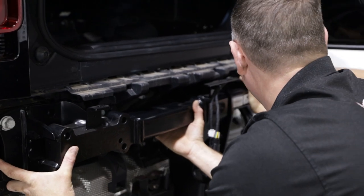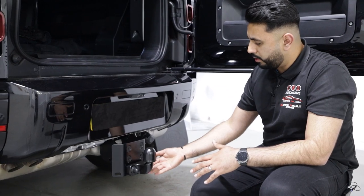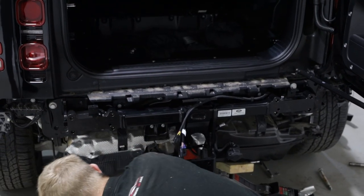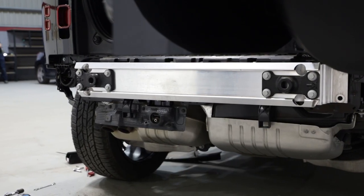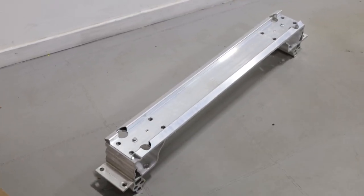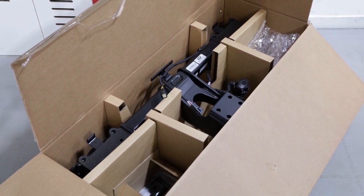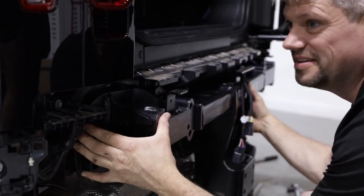It's very versatile, and with the adjustable ball here you can adjust that with ease — unbolting these and bolting them slightly higher up to adjust for whatever you're towing. One really nice thing about this install is that it involves removing the bumper completely and removing this part here, which is the crash beam of the car. Basically this is a safety feature that has been removed, and what we've done is replace that behind the scenes with a stronger tow bar. Behind here there's a whole support mechanism to allow that towing capacity for the vehicle.